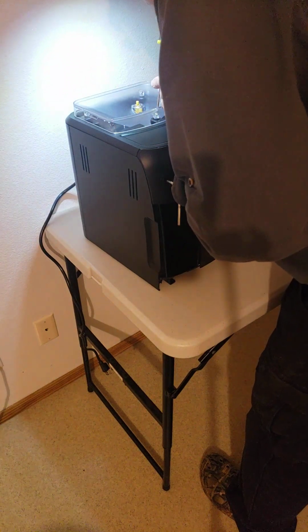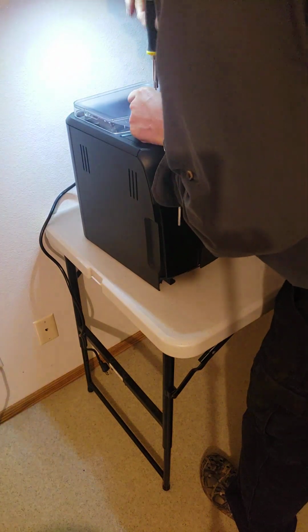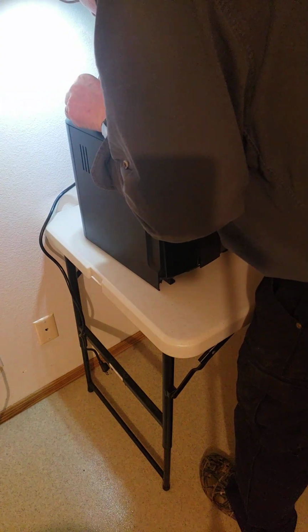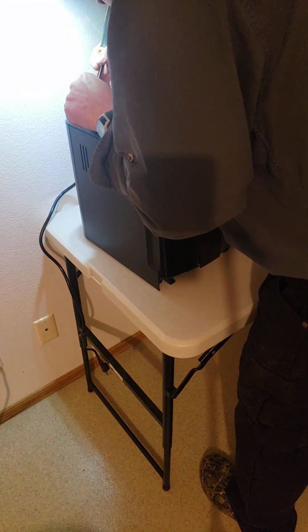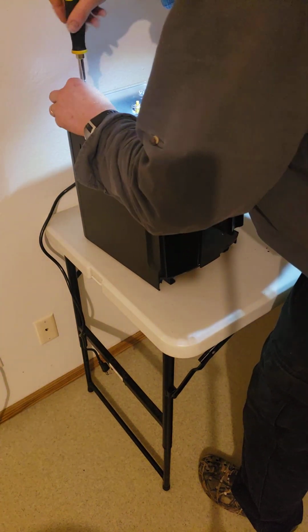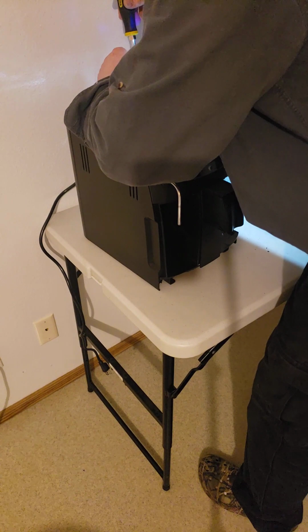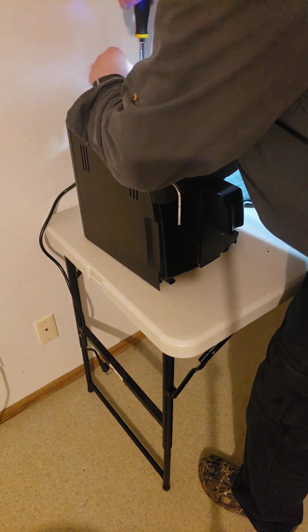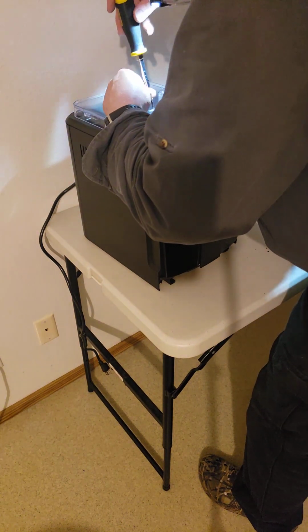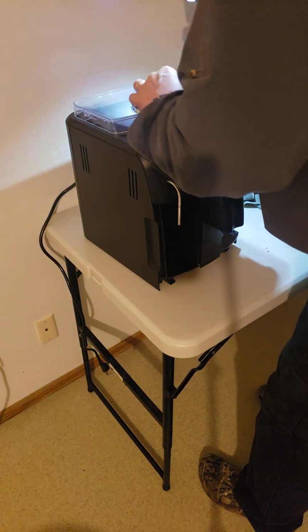And then there were 3 screws in here. Those 3 silver screws, those long. I think these were the longest screws that we had. And remember, just finger tight it. Don't go ham on these. It's just plastic. Next time I'm gonna get a better holder for my bit. I don't like this bit holder. Don't strip these, because on my other machine somebody had stripped 1 or 2 of these. Just finger tight, for goodness sakes. Finger tight is all it needs. Don't go crazy.